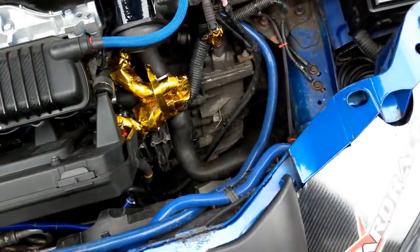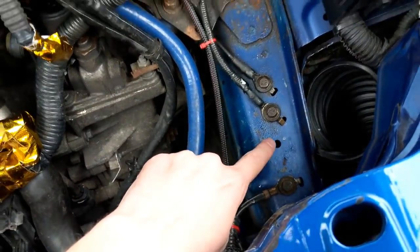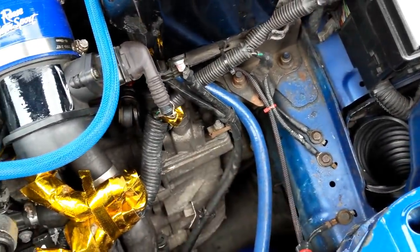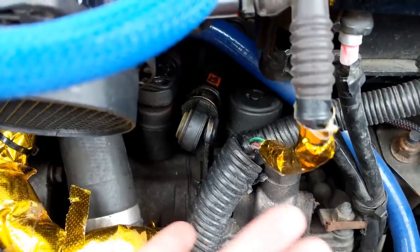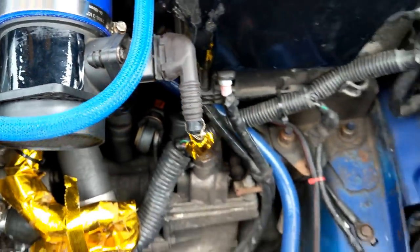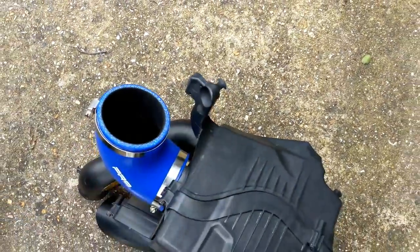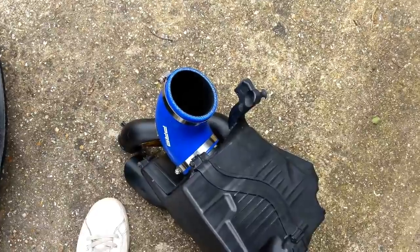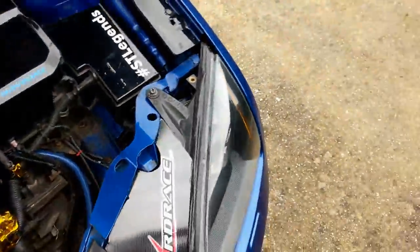So that was easy to remove - you just need to remove the bend and then it comes out nice and easily. As you can see, that's a little hole there. One of the bump stops does go in that but it's too thick so it doesn't really matter - it can't move anywhere. So it's still got this connected to it, but this is what I need to cut off because I'm worried about that part sticking out, catching on the linkage because it sits just above this. Obviously on the other Focuses they have a different sort of connection here sitting to a rubber grommet. This one doesn't have it because it's not really meant for this airbox, but I'm just going to get a hacksaw and chop the end of that off. And also I was driving a minute ago and it's rattling in here - and I know exactly what it is, it's that bracket. I need to take that off as well.